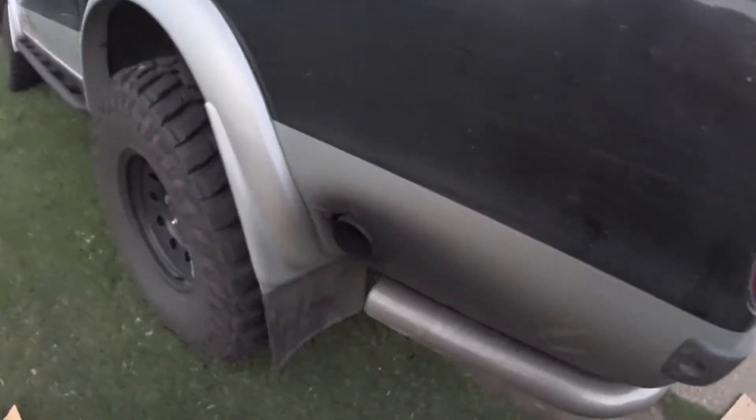I just got the missus to give it a little rev under the bonnet whilst I sat next to the exhaust — there's a slight tinge of gray smoke but no big black clouds or anything. I'm a bit confused because every symptom it was giving was that the pump had slipped around on its mountings and was a bit retarded, but all those bolts were tight. I've advanced it a bit and it's not clackety clackety, so let's check the cam belt tension.